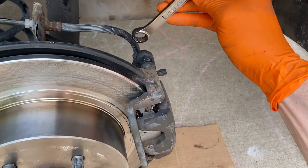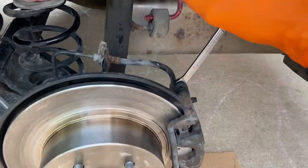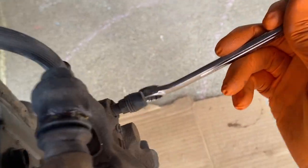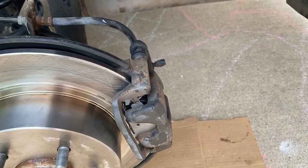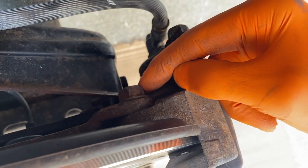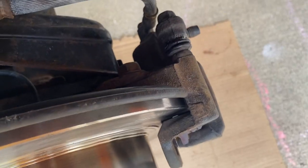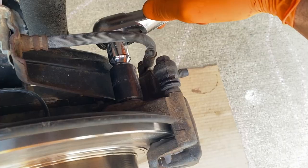You will have to remove your tire — not much to that, just five lug nuts. I'm going to loosen that up, one down below at the lower portion. Now that I've got those loose, I'm going to take off the upper 17 millimeter bolt and the lower one. We've had these off recently to replace the pads and rotors and added anti-seize to the threads, so they will be easier to take off. However, I actually had to use an impact drill to remove them.